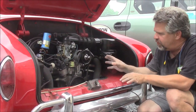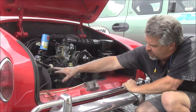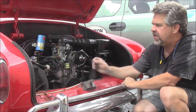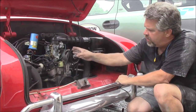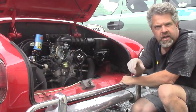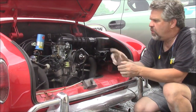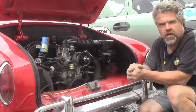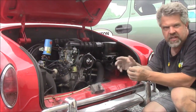It doesn't starve for fuel. It does regulate it. It goes through a filter that you can see. So you've got nice clean fuel going in. You know the pressure is always at 1 PSI. So when the carburetor is set and the timing is set, with the upgraded electronic distributor, everything seems to be much more efficient. We had one engine that we did 1.5 PSI on, and it seemed to be happier. But the other 3 or 4, 1 PSI is the answer.